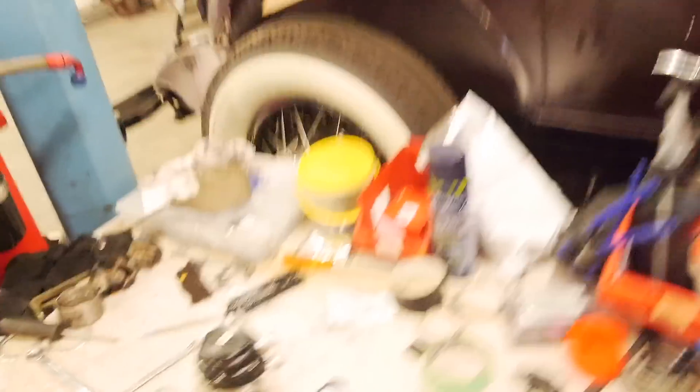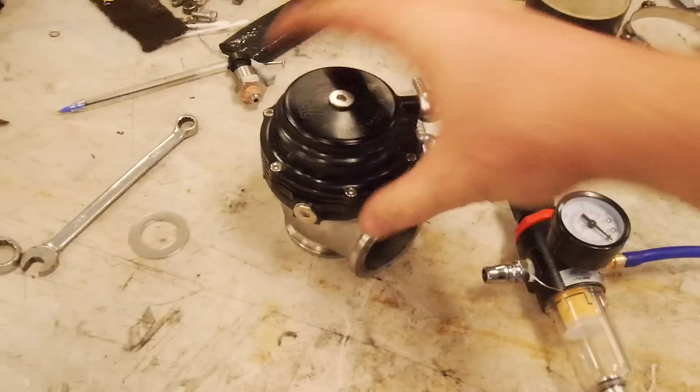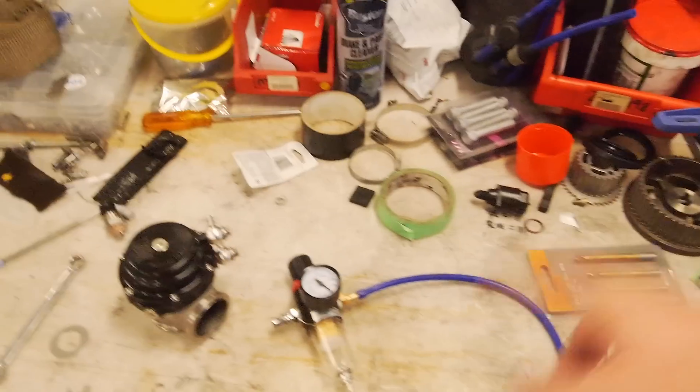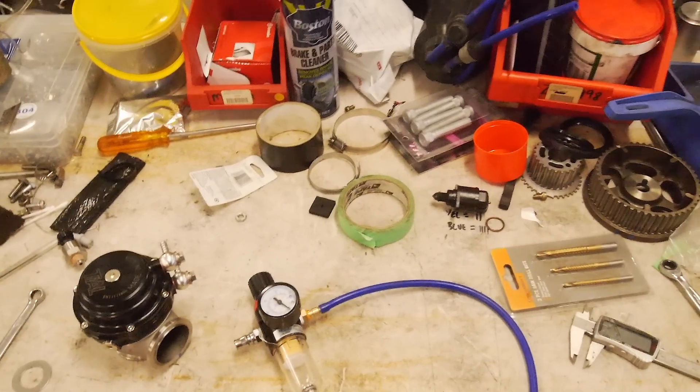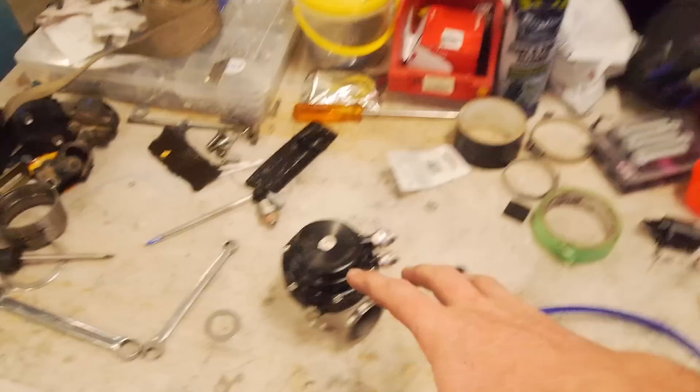While I'm on this, I'm doing the turbo and wastegate and stuff. When I bought this wastegate I couldn't remember what spring was in it, and the paint isn't the best on it so I can't really tell from the paint. So I'm going to show you guys how to set up a really quick, cheap, and simple tester so you can actually see what the cracking pressure or the spring pressure is for your wastegate.